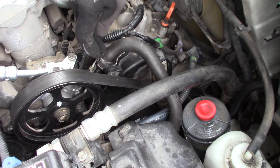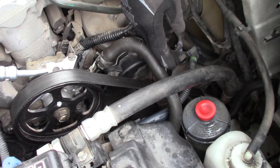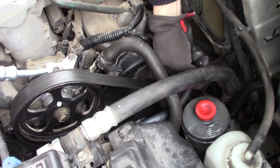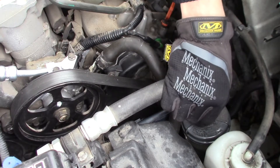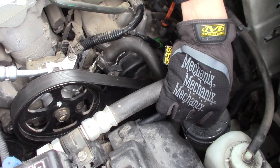If there's a leak in the top right here, then you can allow air to get in, and when you park it overnight and look at it the next day, your reservoir level will be higher than when you left it. You'll also notice some noise, some air bubbles in the reservoir, possibly some foaming. And if you have foaming fluid overflowing out of your reservoir, you definitely have air in the system.